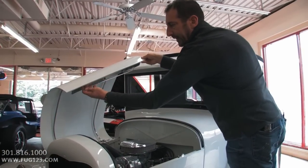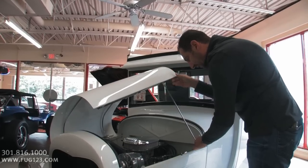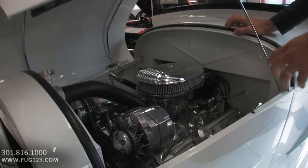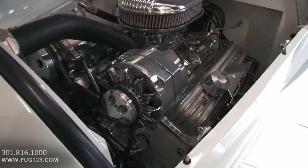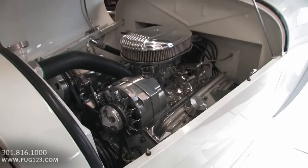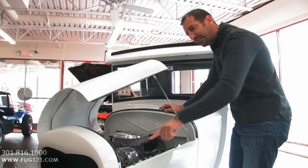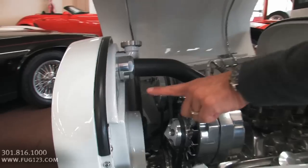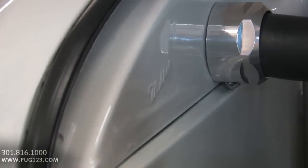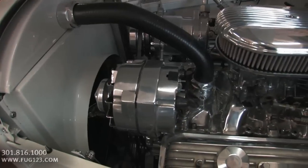We're back to all the things that are polished. This has rack and pinion steering — it doesn't have the old worm and sector like most muscle cars and other street rods have. And not only does it have rack and pinion steering, it's part of the custom frame and it's painted to match the truck. It has this cool old-style Walker radiator that's been re-cored to a new style, with a custom fan shroud painted body color. Everything's polished in here, and there's air conditioning and modern heat.